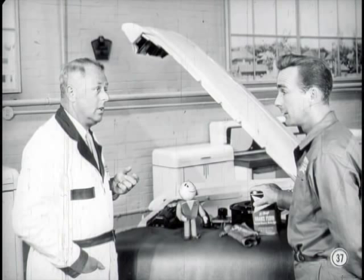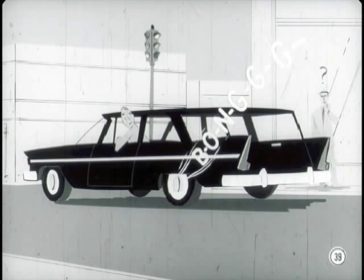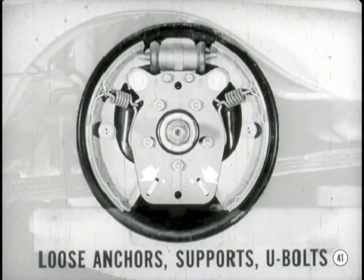What's next on the docket? I'd like to talk a few minutes about diagnosing brake troubles. If you do this part of the job right, you'll avoid wasting time and expense. The first thing: don't install any foreign parts, such as silencers, spacers, washers, webbing, or any other parts in the brake mechanism that are not approved — in other words, no gimmicks. Now, let's consider a report of rear brake howl, especially on Plymouth and Dodge Suburbans. This is generally a bell-like sound that normally comes in at speeds of 20 miles per hour or less and during light pedal application. If normal service procedures fail to correct it, install a set of rear spring insulators like those used on some 1959 models — they will generally eliminate the howl. In cases where the insulators don't correct the condition, look for loose anchors in the brake support assemblies, loose supports, or loose rear spring U-bolts.